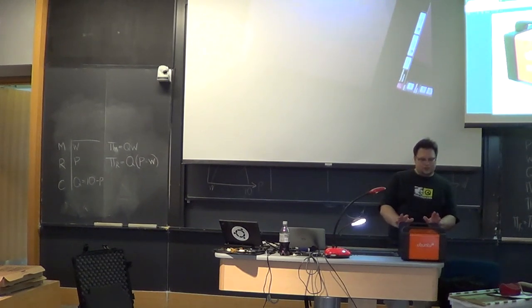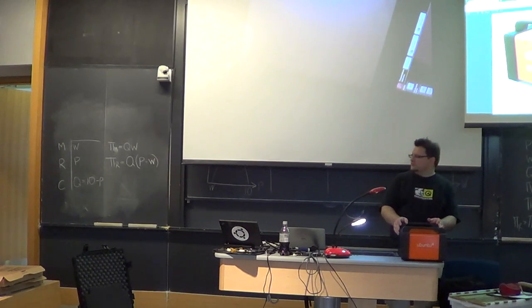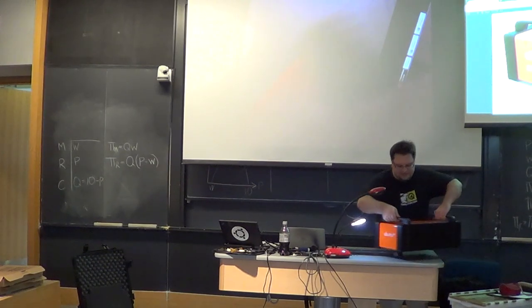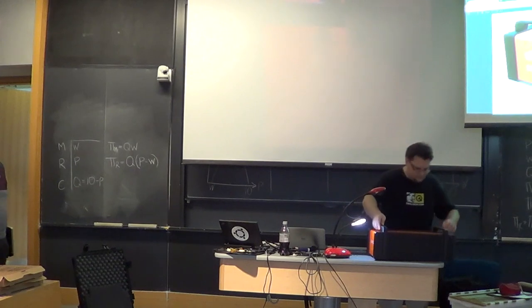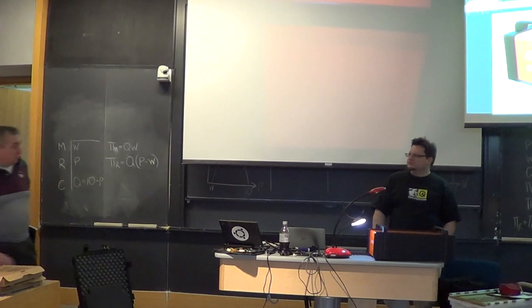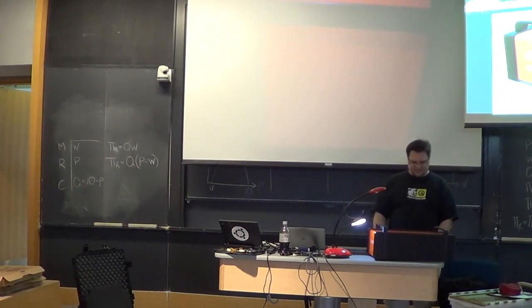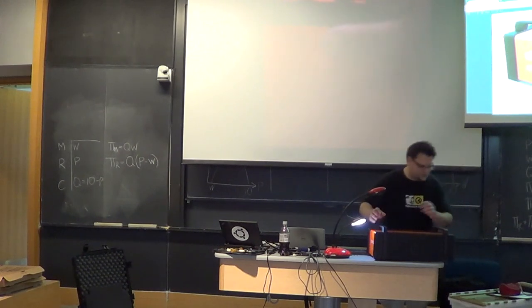This is actually quite heavy because it's basically a heat sink. The case itself is the heatsink for all the machines. Looks the same on the other side. And the compute units are aligned on the sides so that they radiate directly here. If we turn it on, you would see blue LEDs on the sides, which are the reset pins for single units. So this is fanless? It is fanless, except for the switch. Nice. Last time I saw it, the switch was not fanless.